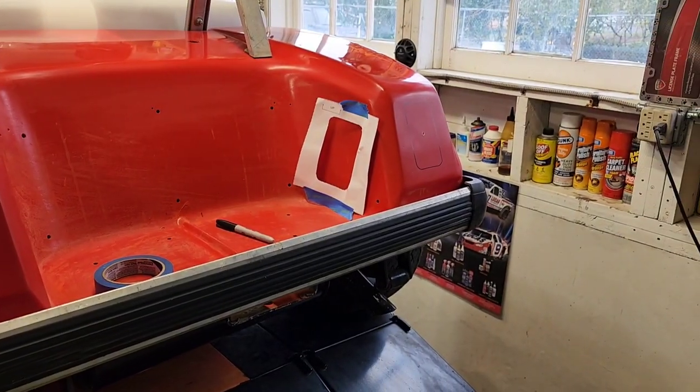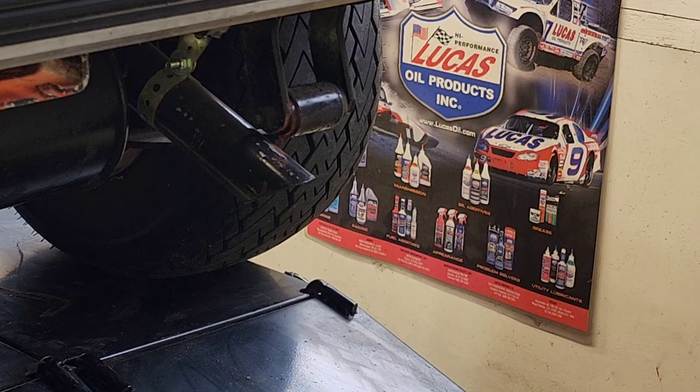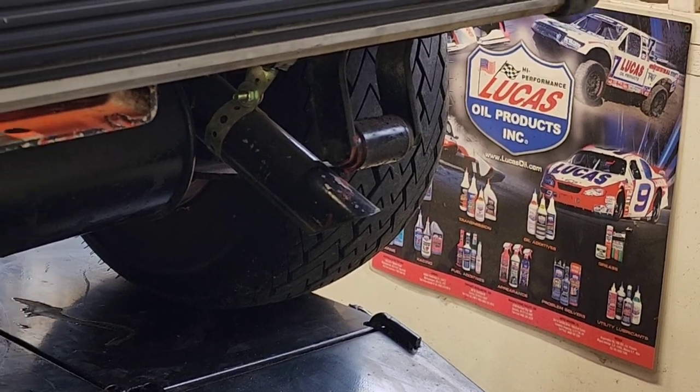The other thing I'm going to do is cut that tailpipe off right there — you can see it is rattling against the shackle. Somebody's done an exhaust on here and it's not that well put together. It encroaches on the space for the air box inside, though it doesn't sound too bad — it's pretty quiet. I'm going to cut that pipe off so it quits rattling. Back in the day I tried plumber's tape to get it pulled out of the way, but it didn't work. When I drove it the other day it was just banging — it needs to go away. We might extend it or turn it 45 degrees with the rear seat on, since you don't want to smell the exhaust back there.